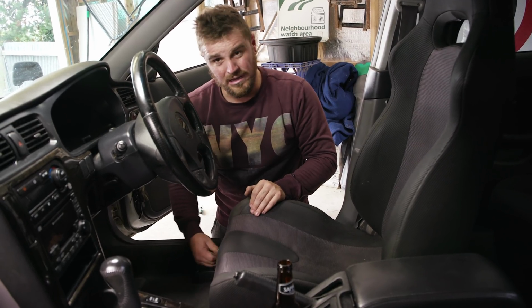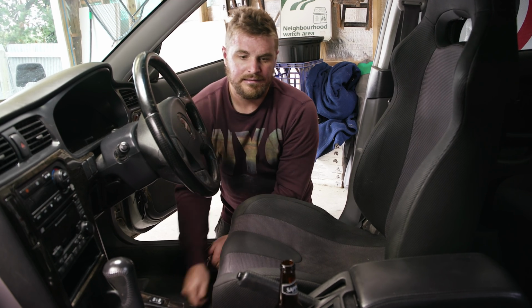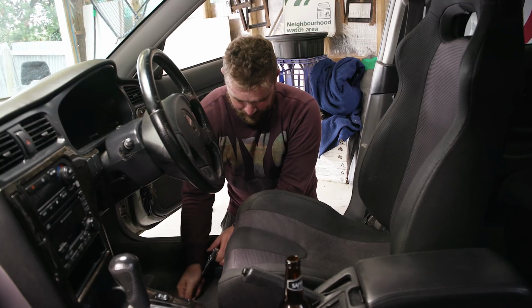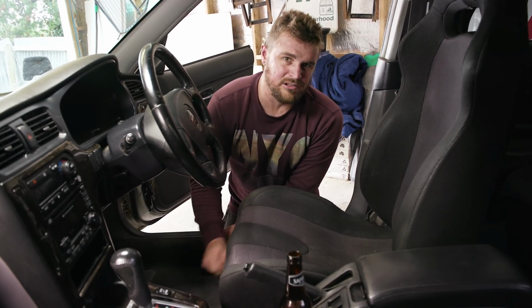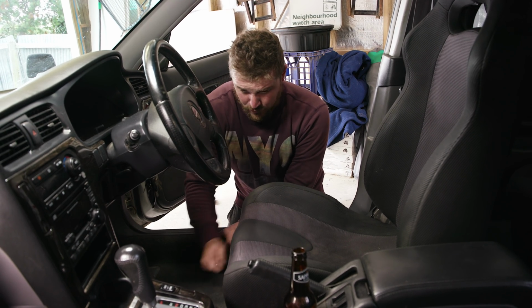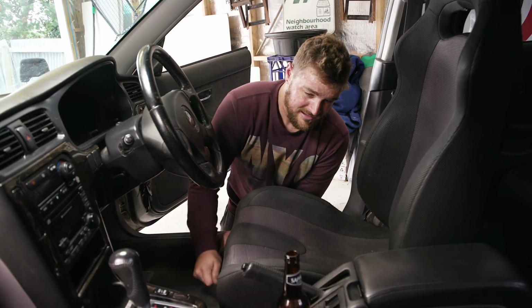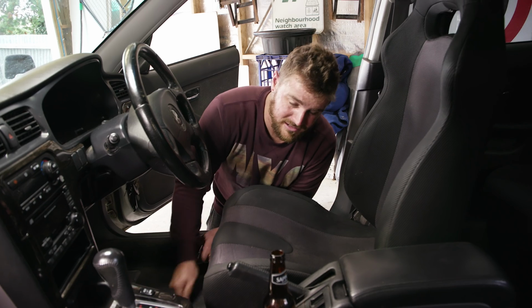So what I'm going to do now, just tighten up the bolts of this seat. And we'll probably have a fun time with the passenger seat. It hasn't taken me that long. It's been like 2 minutes. 14mm, do it up to spec. Remember, you're sitting in these things, you don't want them to go flying out the window.